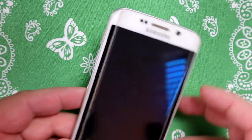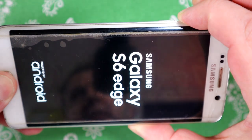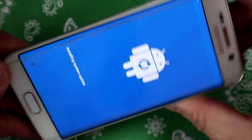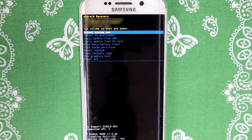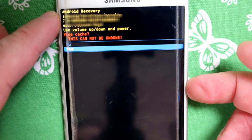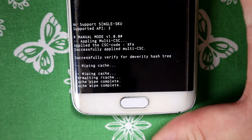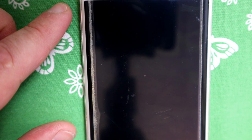Let's do this on the Samsung S6 Edge. To get to recovery mode there is no Bixby button, so you have to hold the power button, the volume up button, and the home button all at the same time. Hold it all together — keep holding it and there we go. Now you can let go and it's going to enter recovery mode. You're going to see the same screen — Wipe Cache Partition. Press the OK button here. Are you sure? I'm going to say yes. You'll see it starts running a bunch of commands and that's done. Now we're going to go to reboot system now. That's step number one.